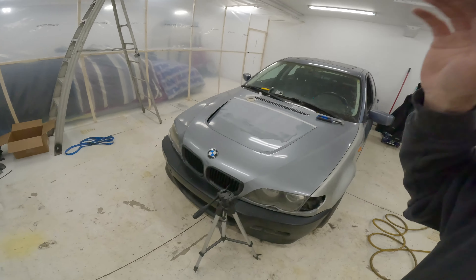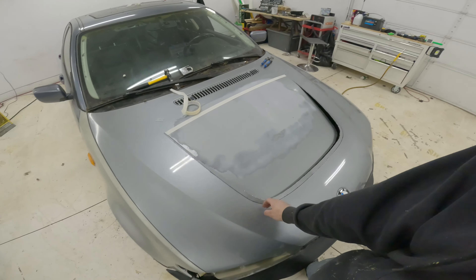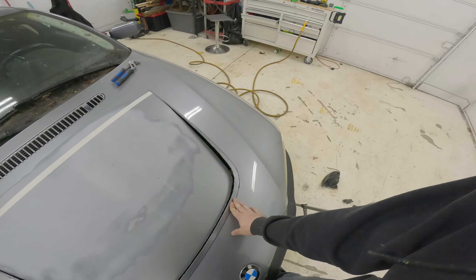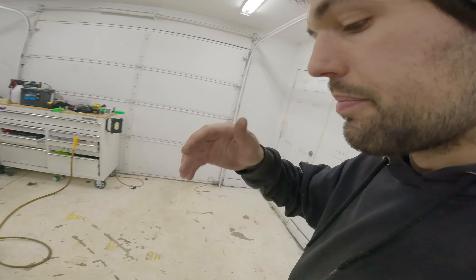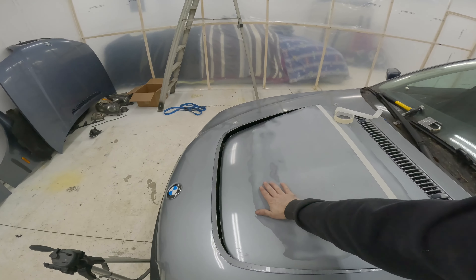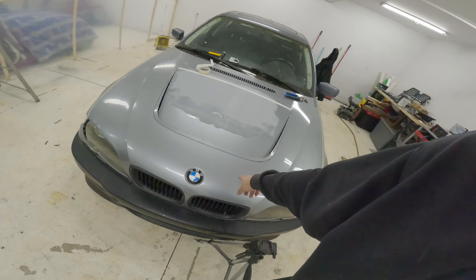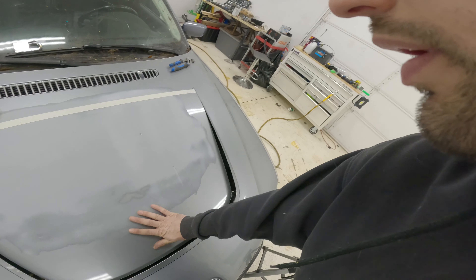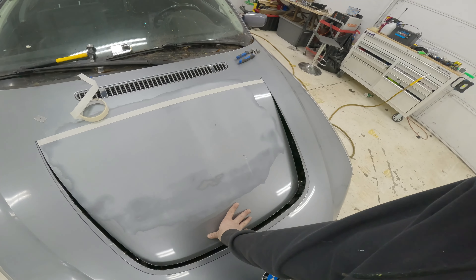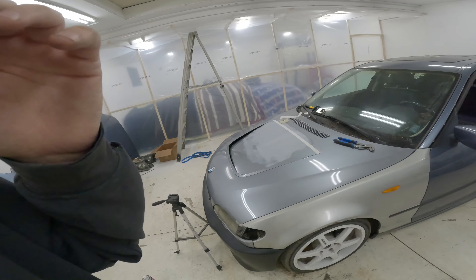Now obviously this is not perfect, but I'm pretty surprised at how well that came out. You can see there's a nice sharp line down here — it's going to get bodywork and body filler. I'm going to be building this out of body filler anyway, but it's nice to start with something decent. This has also added quite a bit of strength to it — it's actually more solid now, which makes sense because you put a bend in there. Now I've basically lifted this edge up by three quarters of an inch — it's not a straight 45, so it's probably like half an inch, meaning I don't have to push it all the way in as much as before. I'm pretty happy with that. I think I'm just going to call it for now and we'll pick it up later.